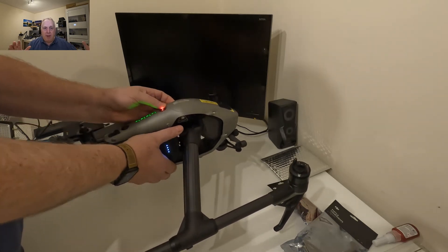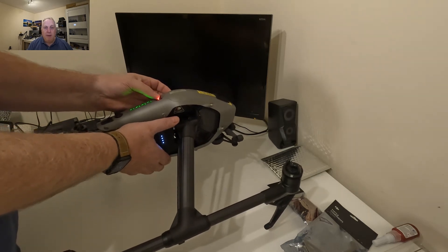What I always do, and what I think is recommended, is lift the drone up and press the power button five times with the opposite hand - the legs move with no resistance because it's up in the air. Some people do that on the ground. If you've got a friction or sticky surface, the rubber feet on the legs can drag as the drone rises up, forcing the legs outwards, and you can break a leg that way.